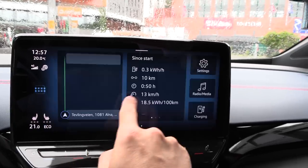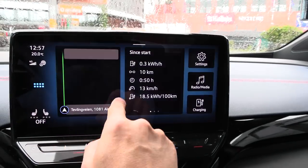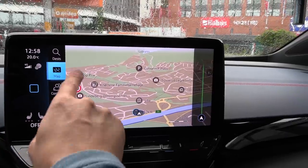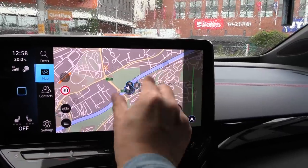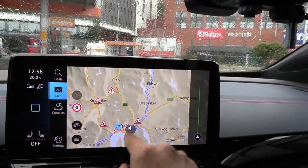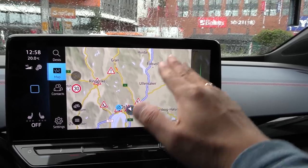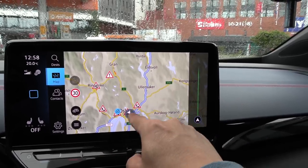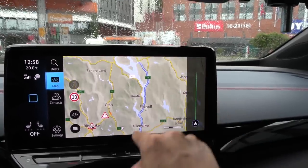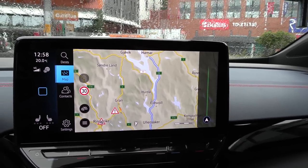So now the plan is to drive north. The HVAC is on. The plan is just to drive. Oh, the lag though. Okay, I had to configure everything here. We will just drive north, because we have low traffic. Drive back and forth. I don't need to follow a 90 test or 120 test strictly, but I don't want to hammer too hard. So I'll probably cruise at, I don't know, 90, 100, 110 kilometers per hour over here, but not 120. Just take it easy, avoid hard acceleration, and then we try to measure the battery capacity.